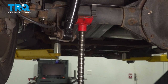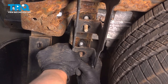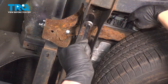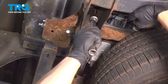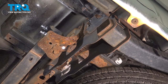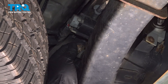Remove the jack from under the vehicle. Once you have your shackle bolts tight, push the hitch up and get the nut started on the bottom bolts. Install the bolts in the back of the hitch — these go to welded nuts on top of the frame. Do the same thing on the other side. Install the stud assembly and get the nut started. Do the same thing on the other side. Install the top back bolt for the hitch.